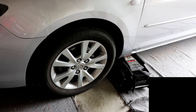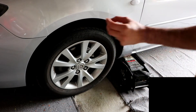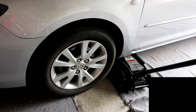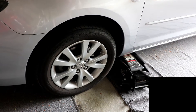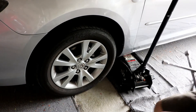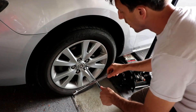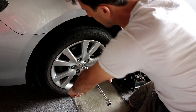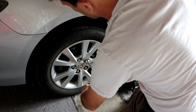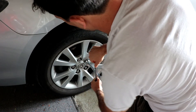This is about a medium difficulty job, as well as jacking up the car, loosening the tire — things like that all take time. First thing to do is just loosen the lug nuts. You want to loosen them now because it's harder to loosen them once the car is in the air, since the tires could move depending on if you have an automatic or not.